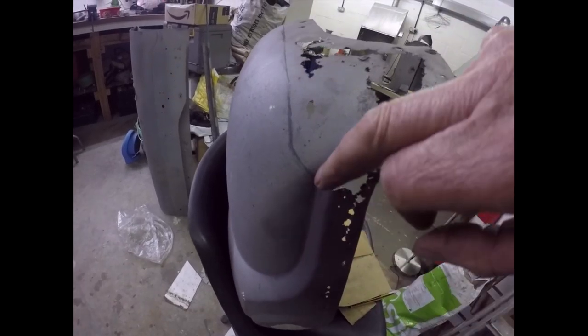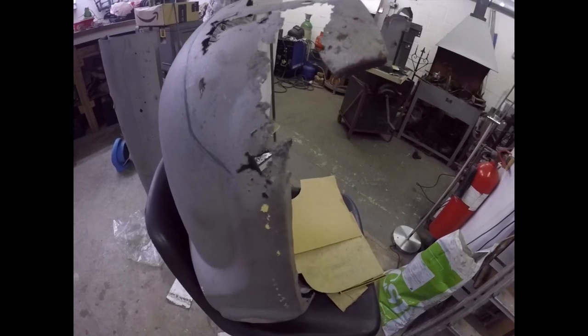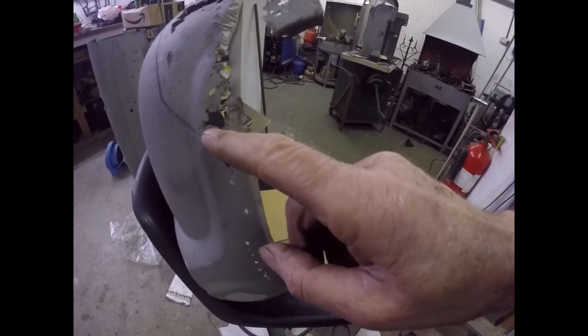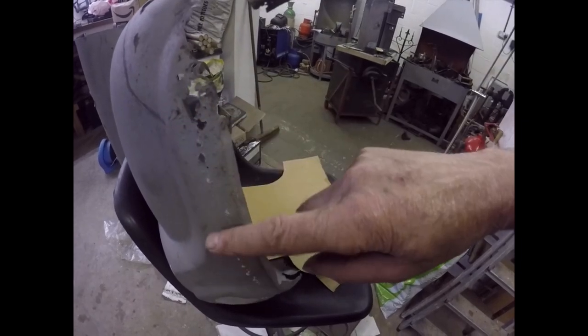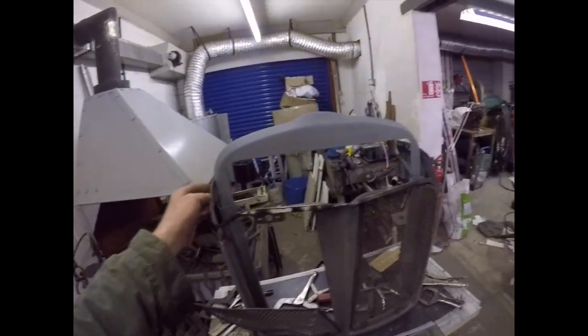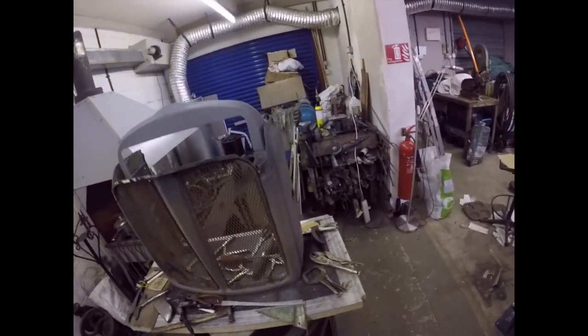I can see this press line here that gradually fades out down there, so by here it will have disappeared and that corner comes on there. I think I'll have a go at making a whole piece first to come to somewhere like that, probably fitting on the inside, then just cut this out, weld those edges, leave the good edge on, weld that into there, then grind it smooth and fill it. We've tidied up and lit the heater because although it's sunny outside it's cold in here.